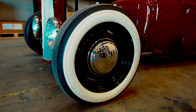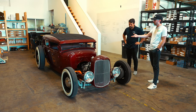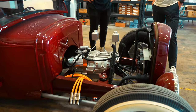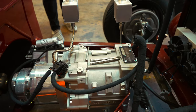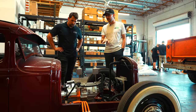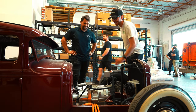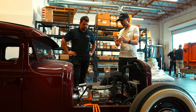It's got a new three-to-one gear reducer, and it's got a new charger in it from AEM. It's really our opportunity to validate systems and also put them on the showcase before we bring them to market. This is currently the electric power plant. It's not technically a Cascadia IM-225 system, but that's what it's most similar to. The Cascadia IM-225 is an integrated module that combines the motor and the inverter. We actually bought them separate, and the inverter is currently removed. When we have the inverter on, we wanted to be able to put it at a raked position so it kind of looked like an old blower on a gas-powered module — just gives it some more texture up front, which is cool when you're showcasing a power plant that's so small and compact.